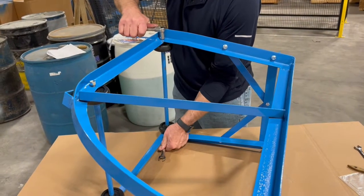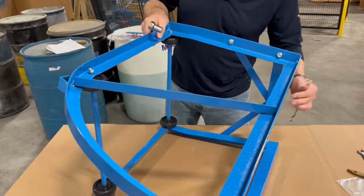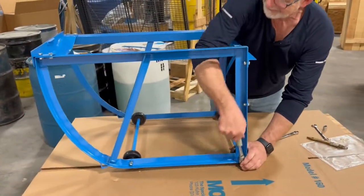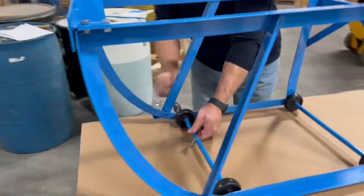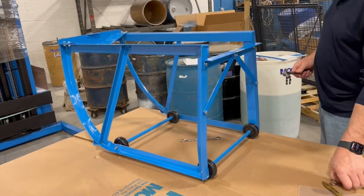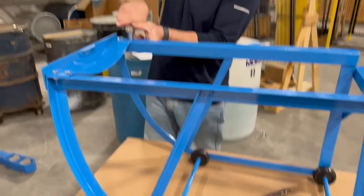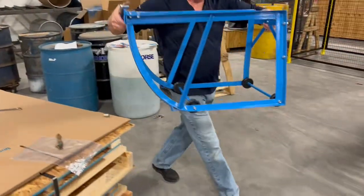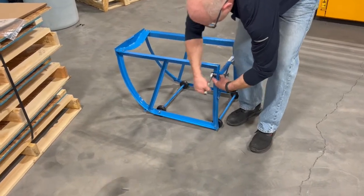So you tighten, then you can start tightening up all your bolts and try to go alternate from left and right to help keep things straight. There's that, and then we'll go back and forth to the other axle. The other axle, 1/2-inch socket, and we'll start tightening the nose piece to the front. Back and forth, alternate left and right. And I would say, yeah, make sure all four wheels are even on the floor, and tighten down the final 4 bolts of the back strap.